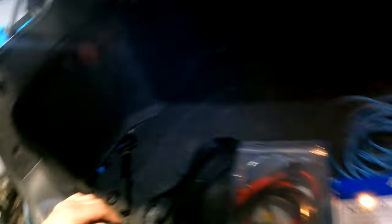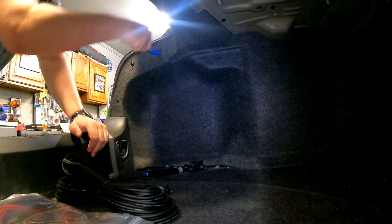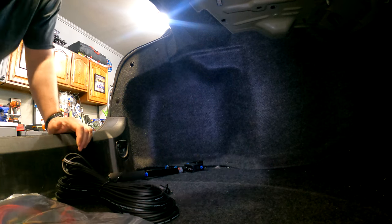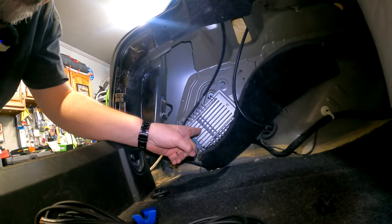To do this we're going to be in the trunk. We're going to take off this cover back here — we're going to get started by taking off the panel on the driver's side to get to that Bose amp. Here inside the trunk it looks pretty straightforward. There's this little net holder part right there to pull off, and then we're going to pop out some of these body panel clip things along the side. Once we've got those clips out and that net holder out, we can pull this kind of out — it's just tucked back behind stuff. We don't have to pull this out all the way, just slide it enough to get right here to this factory Bose amp.